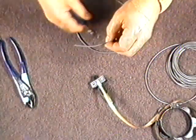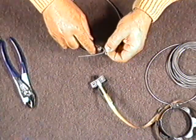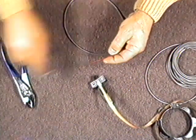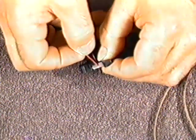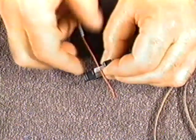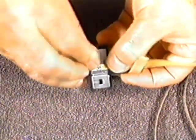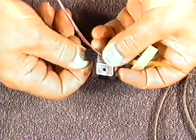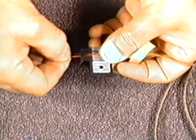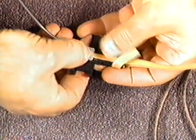Cut about 3 feet of wire and strip back the wire about 2.5 inches. Do not strip insulation from wires inside. Insert wire through the holes in the connector as shown. It doesn't matter which hole the black or the red wire goes into. Carefully fold side A over so that the wires align with the slots in the alignment tool. Pull wire tightly into slots in alignment tool and down as shown. This will assure that they will be aligned with the piercing strips in the connector.